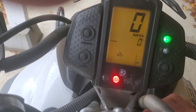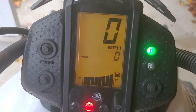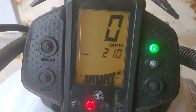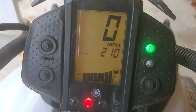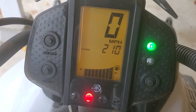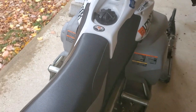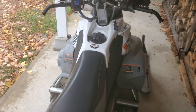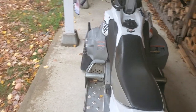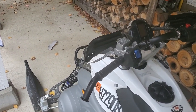Keys on. Fuel pump's running. We'll see the RPM right below the mile per hour gauge there when it cranks. All right — 210 RPM. That's not very good. Some people need more around 300 for it to start, and that would mean buying a brand new or upgraded battery every year or two basically to get the thing to go.